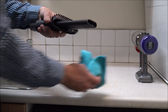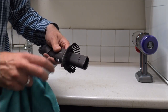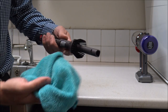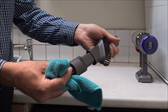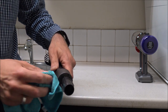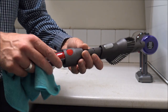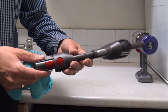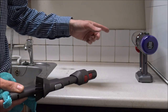Similar to the mini turbo brush — this third tool hasn't been used a huge amount, but I'd normally recommend removing any hairs around the brush part first, then getting a damp microfiber cloth and giving it a wipe round to make sure the connection at the end is nice and free of any dirt or dust. If you've owned this for a couple of years, the end can start to get a bit dusty, and if it's not connecting properly to the main body it might not work as it should.